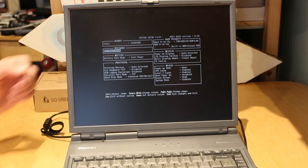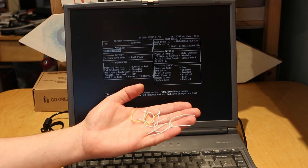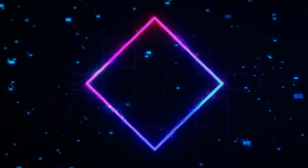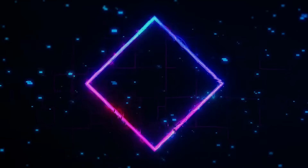We've proven that using paper clips can indeed circumvent the BIOS security in early Toshibas. We've also shown that in this particular case you also need a hard drive present in the system for it to get past the boot stage. We'll be using this system in another video. I'm going to have a little play and see if I can get it to recognise this slightly larger drive — it's supposed to be a 6GB unit and I think there's a 20GB in there. Anyway, I hope you found the video useful — please like and subscribe, and we'll see you on the next one.